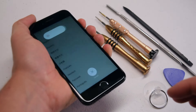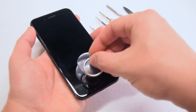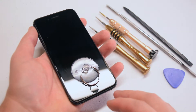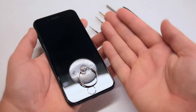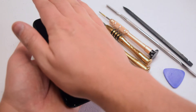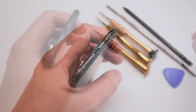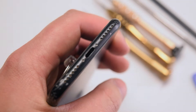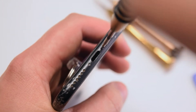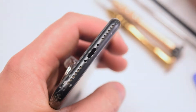Make sure to turn off the iPhone before we begin. Place the suction cup right above the home button. The screen will need to be slid down first and then flipped open like a book. Locate the two Pentalobe screws near the charging port that are holding the LCD to the phone chassis, and go ahead and remove the two screws.